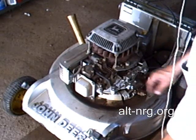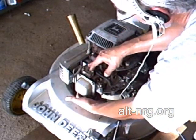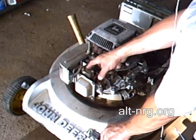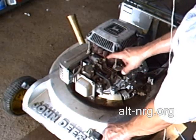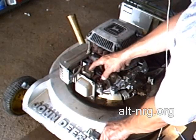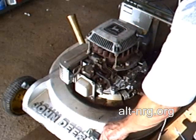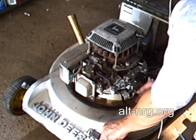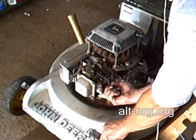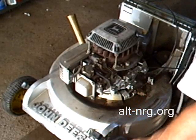Next phase obviously has to be now to locate the camshaft output so that I can attach some sort of pickup assembly that's going to allow me to electronically, every other rotation of the flywheel, cancel out the spark so that I don't end up with a waste spark at the top of the exhaust and the beginning of the intake stroke. I'll be using a basketball filler needle to inject the HHO directly into the top of the engine, right above the intake valves. And that's it for phase 1.